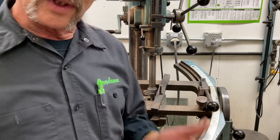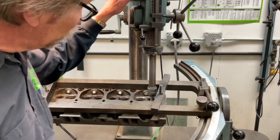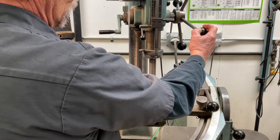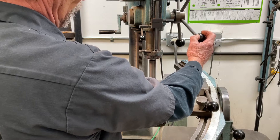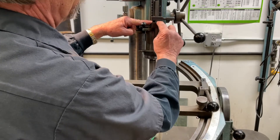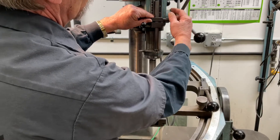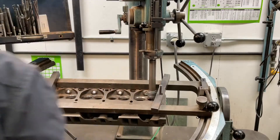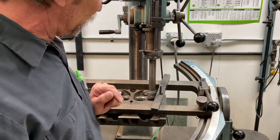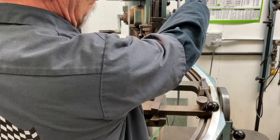From that point, this is a dry operation we're going to cut. I'm going to do it in a clockwise motion. Come right in here — as soon as I make contact, I'm going to go ahead and lock that quill down. Then I can set my seat ring depth here; say it's going to be a quarter inch thick. Set that to quarter inch, and I will confirm that with the actual seat ring set up in there to set that depth. Once that happens, I can release the quill lock, and I'm machining.